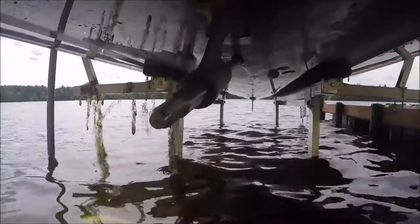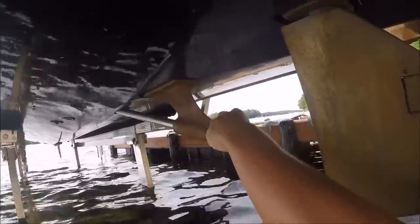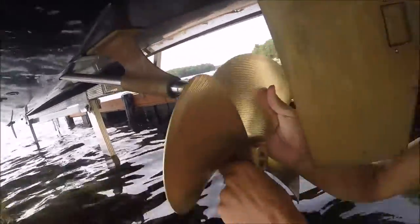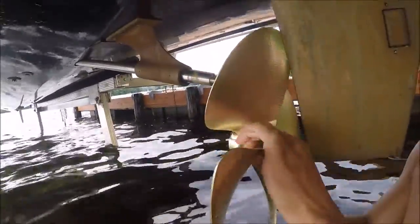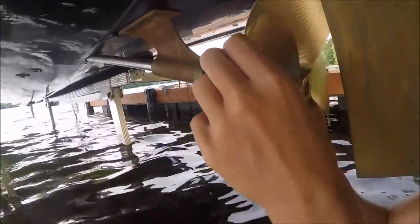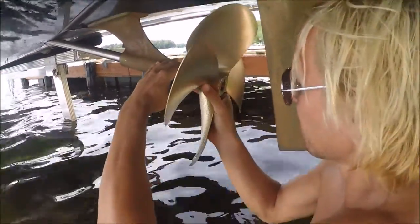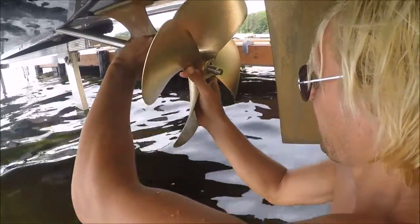You can inspect — everything looks good. We've got the key back now into position, just using the original key. There's no damage to it. Put your prop back on and make sure it's facing the right way — the size and everything should be facing towards you. We want to make sure that the key slot is properly placed on top. Slide that in, very slowly, making sure it's guiding right on that key slot. There she goes.